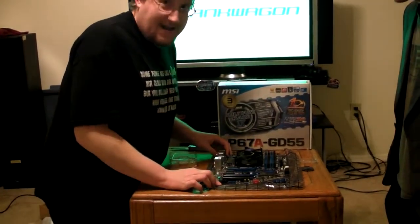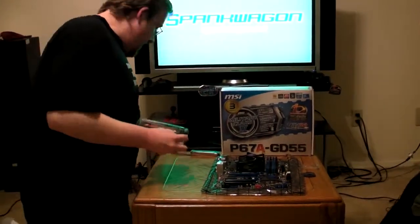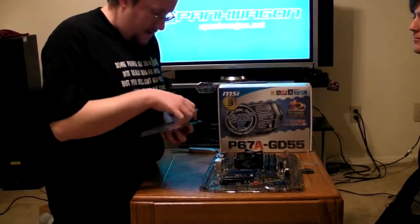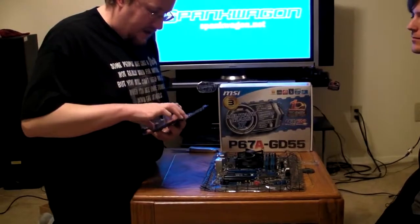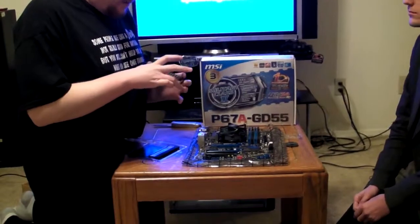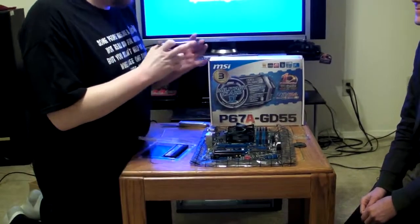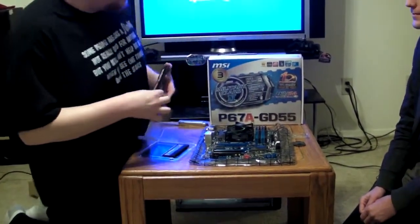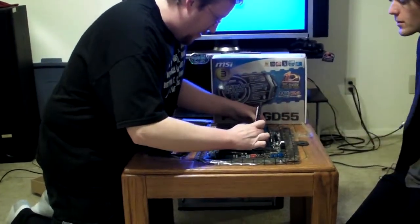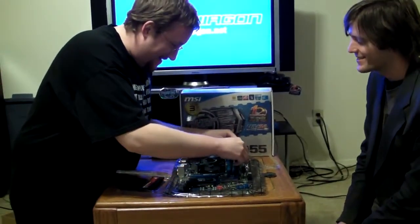So, next, memory. I still can't believe I only got 8 gigs. Here's the thing. Because of what we're doing, it would actually fit 4. But because I eventually plan on upgrading our software, I want to go with 8 just in case. So Patriot Sector 5, DDR3 1600. So 8 gigs, 2x4. Actually, we'll just do the blue ones here.